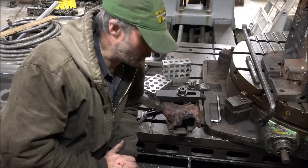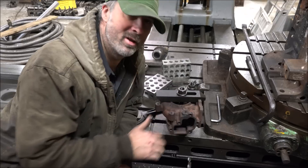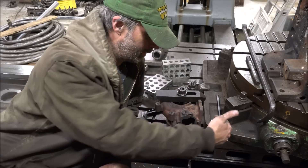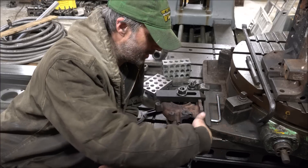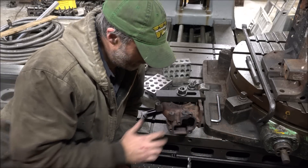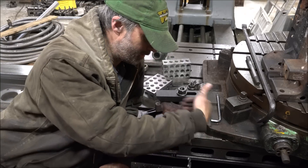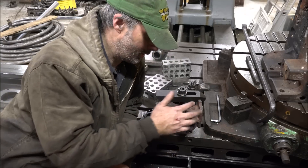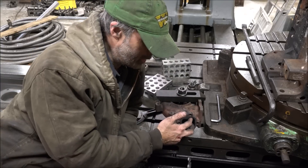What I've got here — I'm going to start with a half-inch drill bit, and I'm biasing this so that as the exhaust comes in, it will easily be able to make the turn and come out through the gate. I'm keeping it in the flow direction. If it has to make a square sharp turn, it's not nearly as efficient. So I'm going to try and open these up a little bit.